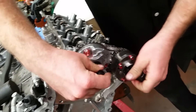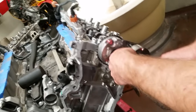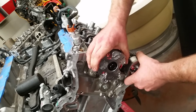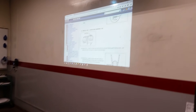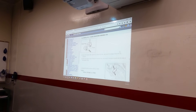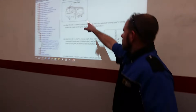From there we're good to go ahead. In this video we're not torquing everything to spec — we're just running them up to show how you do it. Now, if we didn't have those pins locked in, we would have just driven the controller onto the knock pin and damaged the controller permanently. So from there we go to our next steps: our number one chain. We'll refer again to service information. Remember, number one chain right side — but we're on the left side from the perspective of the transmission. Left side, we've got a couple marks. One you can see: a tiny dot.